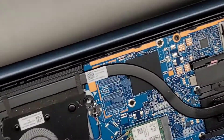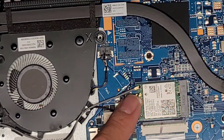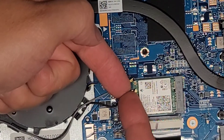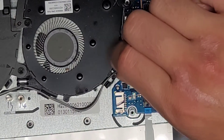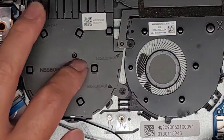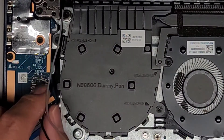It looks like we're going to have to take the screen and the hinges and everything out to be able to get the motherboard out. Let me go through removing the wireless card antennas. We have the wireless antennas here — the gray one goes to the white arrow, the black one goes to the black arrow. We're going to go from the tail and just pull it straight up, using two fingernails. Then we can unroute this and move the stuff out of the way.